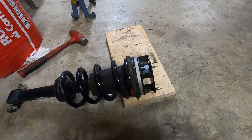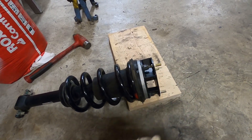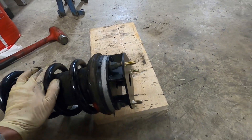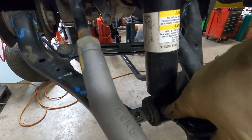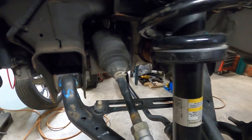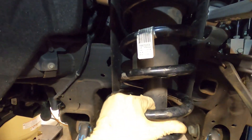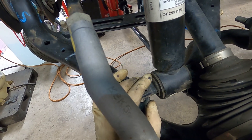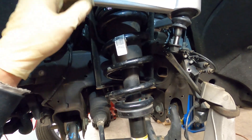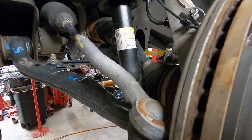Three of them at 45 foot-pounds. You kind of have to keep the spacer up, start the nut, and tighten them all down at the same time because there's not much room there. With that installed, we're ready to go back in. You take it, slip it down through the hole with the bottom part spun, then pick it back up - it actually goes back in pretty easy. We have the new flange nuts at the top started - nothing's tight yet, everything's loose. They want you to pull the factory clips off the bottom of the strut and use a nut and bolt they supply. With the upper A-arm, end spacer, and the little spring tension spacer at the bottom, we're ready to start going back together.